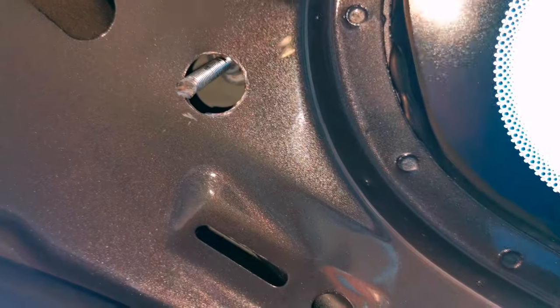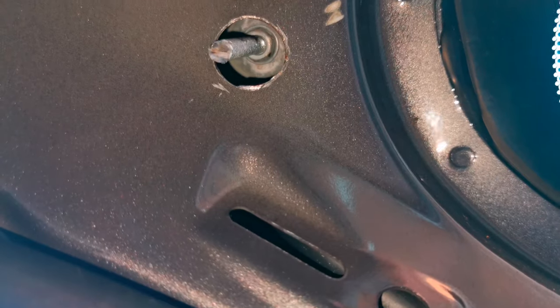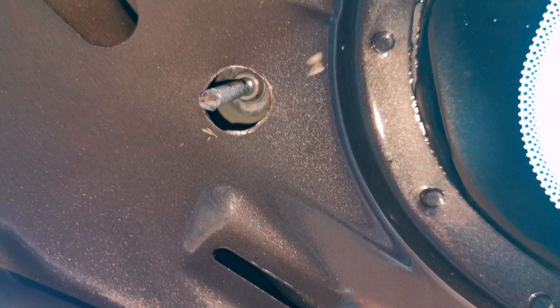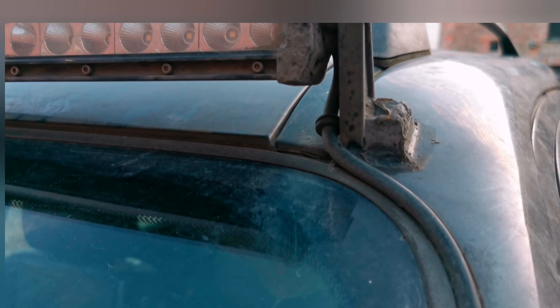The inside of the roof on the Freelander is actually double-skinned, so I had to drill through both skins on the roof. Then I had to use a drill bit with a circular bore piece on it to make a bigger hole, to get the washer and a nut through for the bolt. It's quite likely that on your vehicle the roof will be double-skinned as well, so you would more than likely have to do the same.